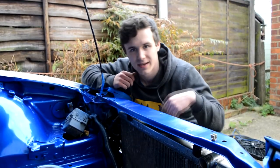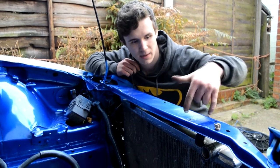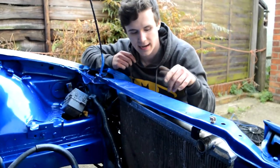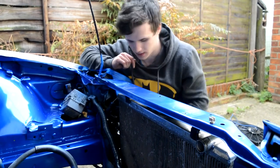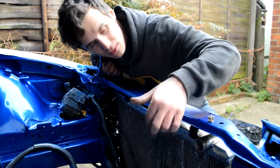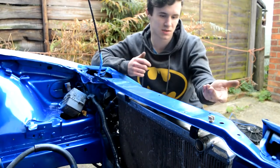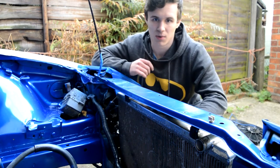What we ended up doing is taking the original mounts from the radiator that mounted up here on the top and basically bending them over so they now mount into the front here. The radiator had two convenient little tabs on there already pre-threaded and everything, so we just screwed them into there, screwed them up to here, and it seemed to work good. The next stage is just making the bottom mounts.